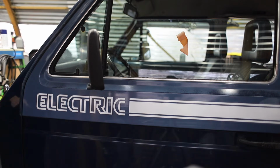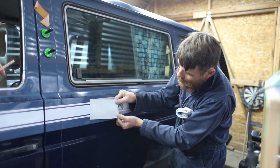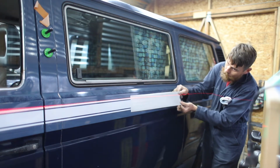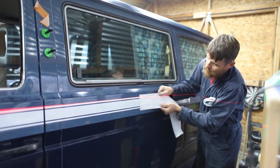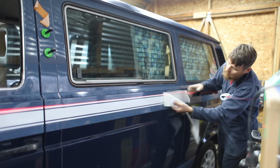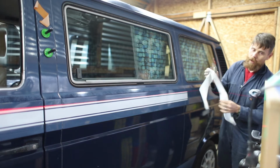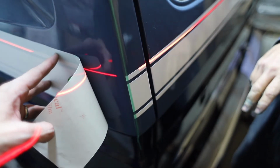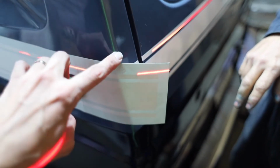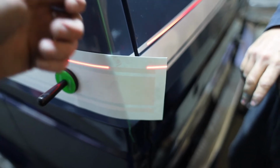Oh yeah, I'm very happy with that. Very satisfying, gotta say. So for this corner, we're gonna have two pieces of overlapping vinyl. This is actually gonna cover it. And in order to cut that, we're using this green knifeless edge tape. So basically, once it's down, we're gonna reveal this microfilament in here, and it's gonna cut through it.